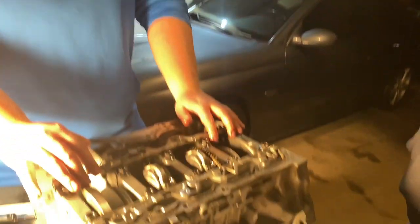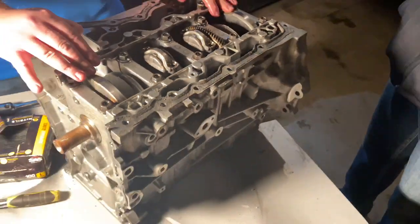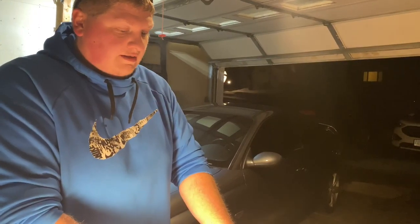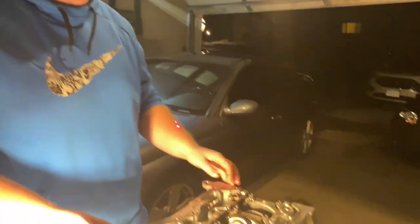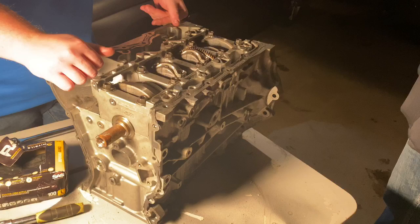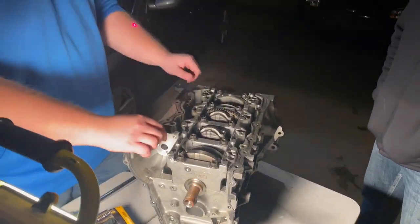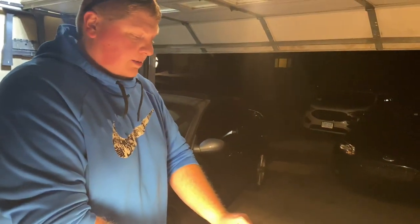The point of needing a balance shaft is it produces vibrations. They're balanced, but they vibrate a lot. The GT350 Mustang is the largest ever flat plane crank V8 ever made, just because the bigger you get, the more vibrations you get. A 2.3 is considered a large four-cylinder engine — the bigger you go with displacement, the more vibrations you have and the harder they are to balance. Vibrations aren't great for longevity or comfort.